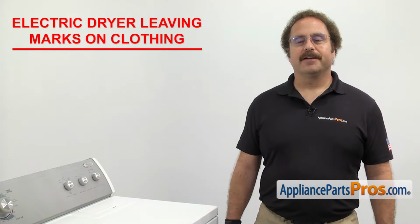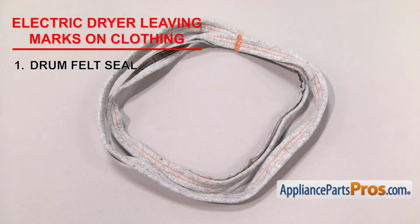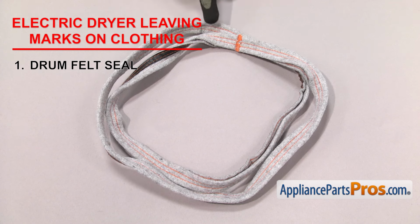The first thing we need to inspect is the drum felt seal. It's what keeps the hot air inside the drum. If your clothes are getting marks on them while drying, it's possible the seal is worn out. If it has, then the drum could be lifting up as it turns, allowing the clothes to be pinched between the drum and the bulkhead.